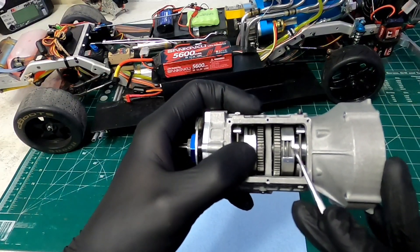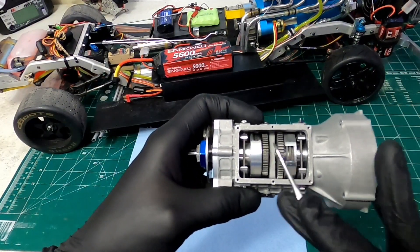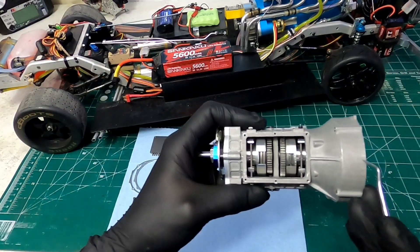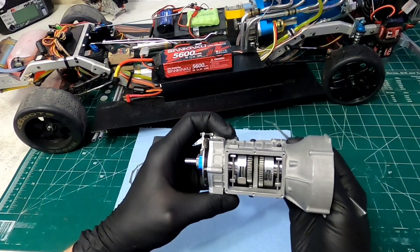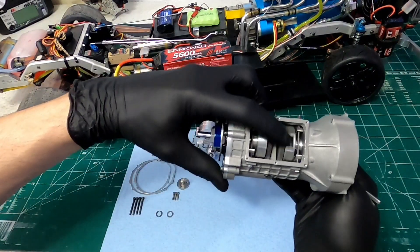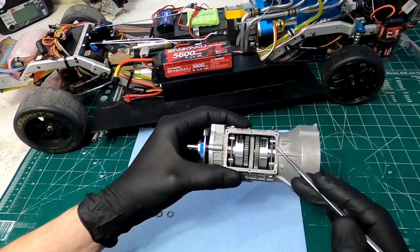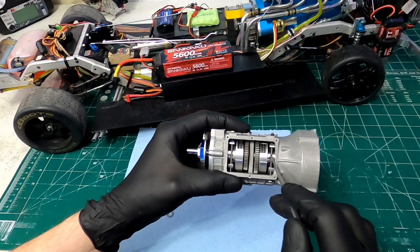Looking at underneath, here's how it works: you have individual little plates, two locking plates, a drive plate in the center, and clutch plates sandwiched in between — one here, here, and here. This setup is on all four gears, so I'm not sure why they call it a dual-clutch transmission when it actually has four clutch assemblies. These are the shifter yokes, and when you slide one over, it presses the clutches together and engages that gear. On this side you have reverse and first gear on a hex bolted to the main shaft.